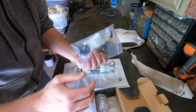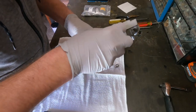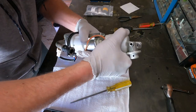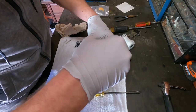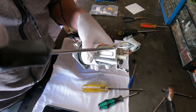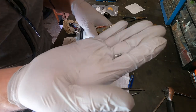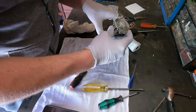Here's the kit — there's the pump. Let's start taking apart the original factory unit. Go ahead and grab a flathead screwdriver and pop these clips up. Be gentle with them. Go ahead and pull it apart — got a little bit of fuel coming out. Go ahead and disconnect the electrical wires going into the pump. There's a Phillips screw in there. Man, that was on there tight. Let's get this screw out. Looks like a little tiny washer in there, so be careful when you separate that. This is exactly why I'm doing it prior to the trip and not on the side of the road.